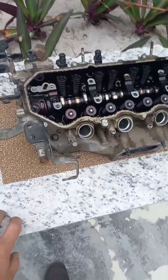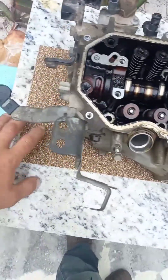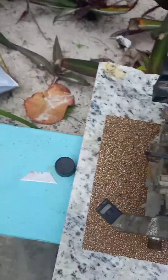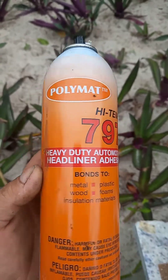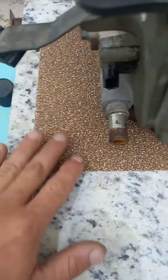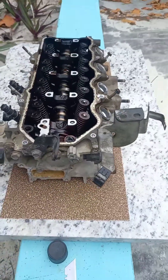Get something completely straight and flat. As you can see, I have two pieces of sandpaper. I'm starting with 40 grit because this head is pretty bad. I glue that down with headliner adhesive — any kind of spray-on adhesive will work. You spray that on the sandpaper and on the piece of granite, and that's how you fasten your sandpaper to the granite.